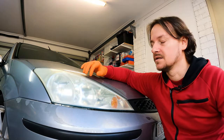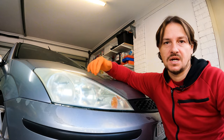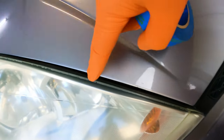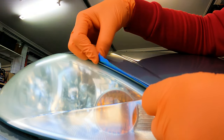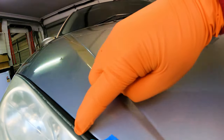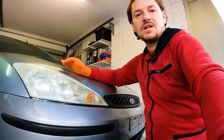The next stage is to mask up the area — you don't want to accidentally sand the body panels. Go around with some tape. On the Mark 1s, there's a little rubber trim piece, so try to get the tape underneath it so that rubber piece is protected as well. Get it underneath the rubber, peel it back, and the rubber piece will be protected — you're not going to start sanding on it. I'll go through and do the rest of this headlight.